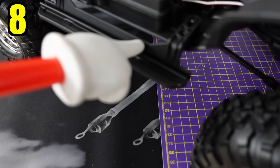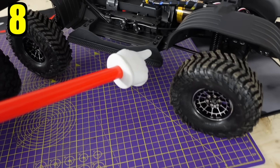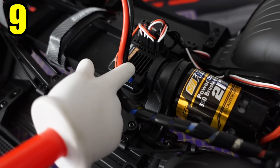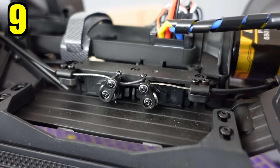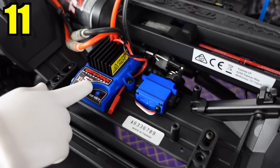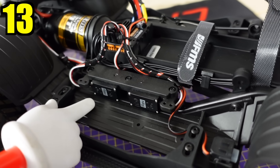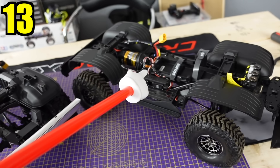Sidesteps on both — yes, they've got a ridge where you can put the body, same as the other, but that's not a new thing, loads of stuff has that. The receiver box pretty much takes up the whole side on the TRX4. No receiver box on the FMS side because it has a 2-in-1 ESC. What we do have on the FMS though is the remote locking diff servos — that's how they're mounted — versus the TRX4's. Battery tray on both, ESC and 2-speed selector servo on the TRX4. On the FMS side you've got a 2-speed gearbox selector and a dig function — the TRX4 doesn't have dig. This does have dig, which means the gearboxes are also different.